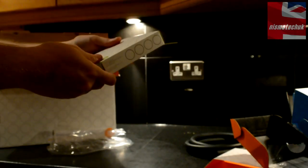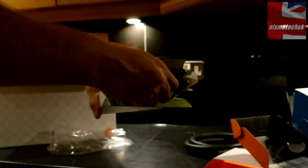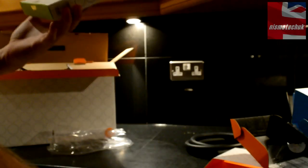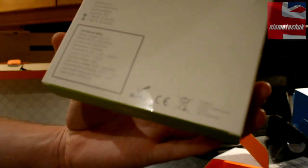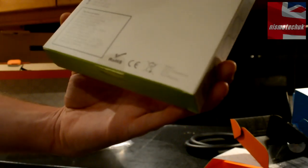What else do we have in the box? So here we've got an EK silent fan. I'm interested in seeing what these are actually like — EK generally don't manufacture fans. Looking at it, it's a standard black 120mm fan with standard blades. Technical data: it's a 12V fan, 1600 RPM, airflow is 58.8 CFM, noise level 25.8 decibels, 120mm by 120mm by 25mm. Static pressure is 1.7, which isn't the best but isn't the worst — it's good enough for water cooling.